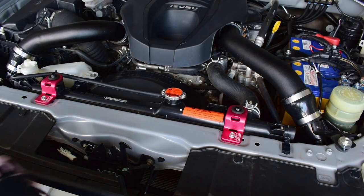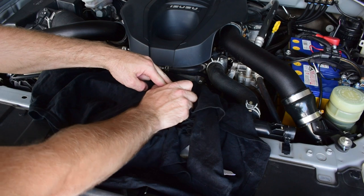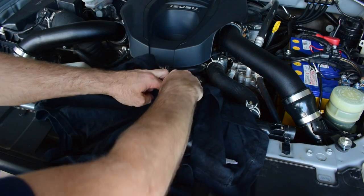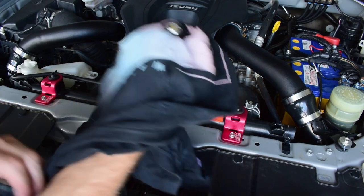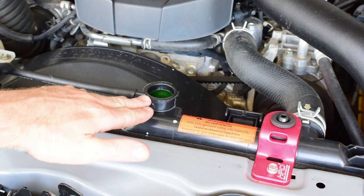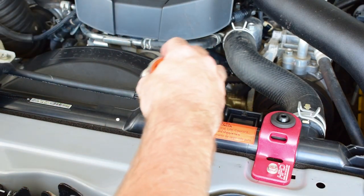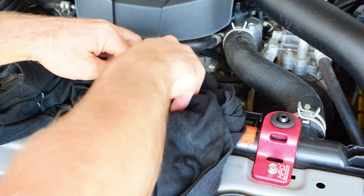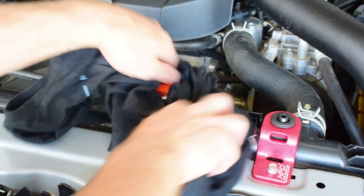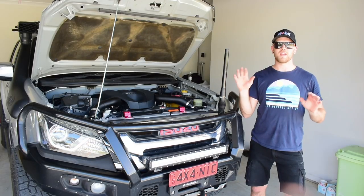It's time to do our final coolant check. The vehicle has cooled down and now we can check the level of coolant in our radiator. I'll put my rag over the radiator cap again, slowly loosen that off, apply some pressure down, and gently remove the radiator cap to check the level. I've just topped up the radiator with a little bit more coolant so it's right up to the brim — now I know my cooling system is full and the level is correct. I'll pop the cap back on, give it a wipe down to get rid of any excess coolant, and the coolant change on the MU-X is all finished.